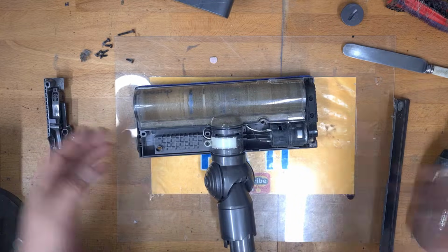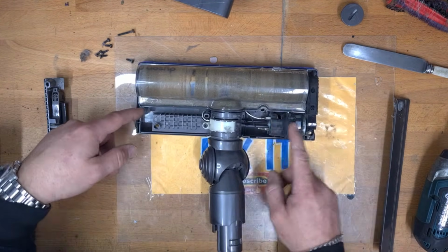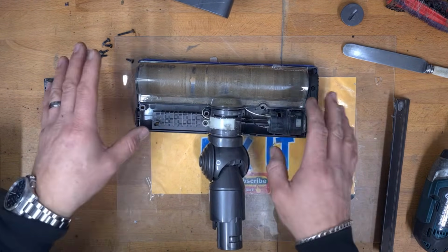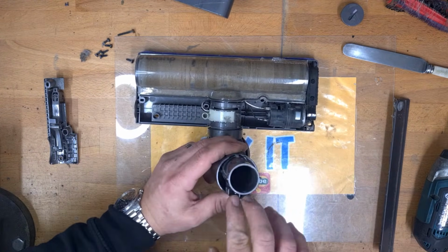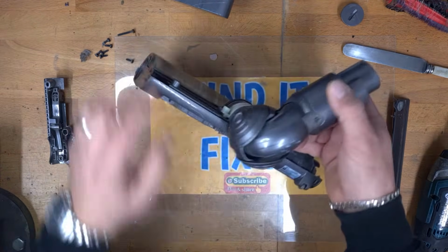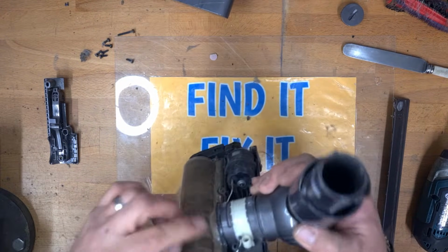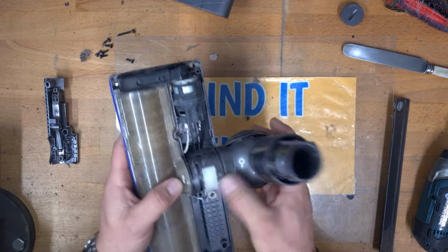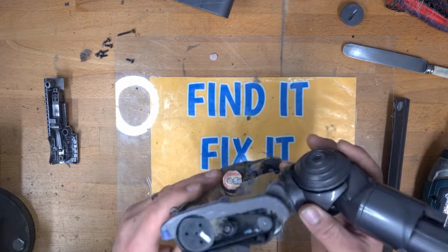Once the top cover is removed, you're then inside the brush bar housing. So that's your electric motor. These get dusty. It's worth checking the connections on the back of here. If your brush bar isn't spinning at all and you've diagnosed you've got power down to these 2 contacts here, it will then either be a broken wire between here and here, which goes down through here, round the side, and then in here, and then it rotates. So yeah, your cable will then come in here at the top. So it could be a broken wire somewhere, or one of these could have come off.